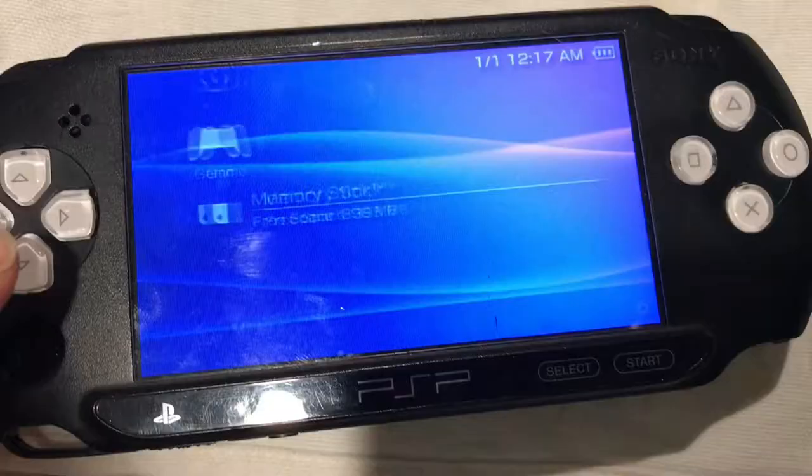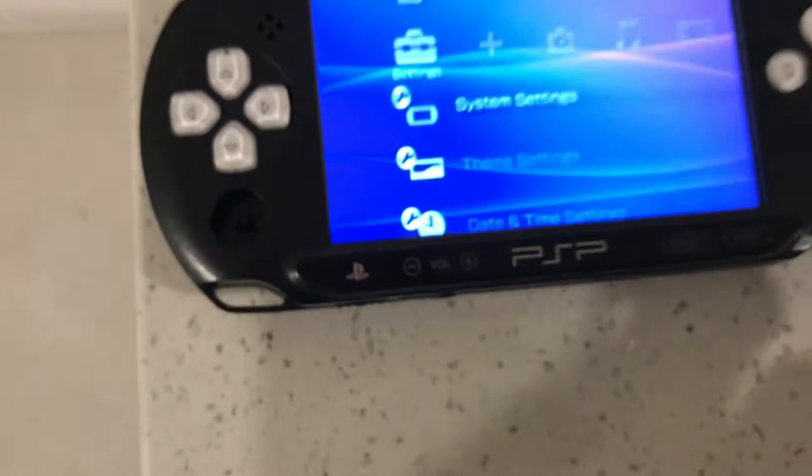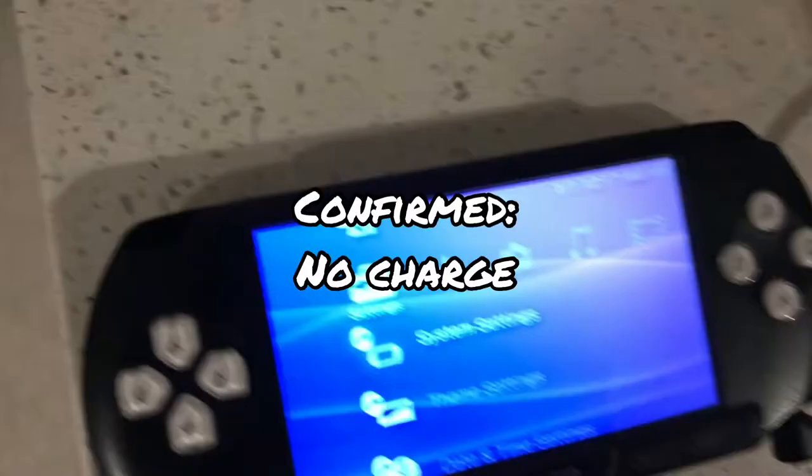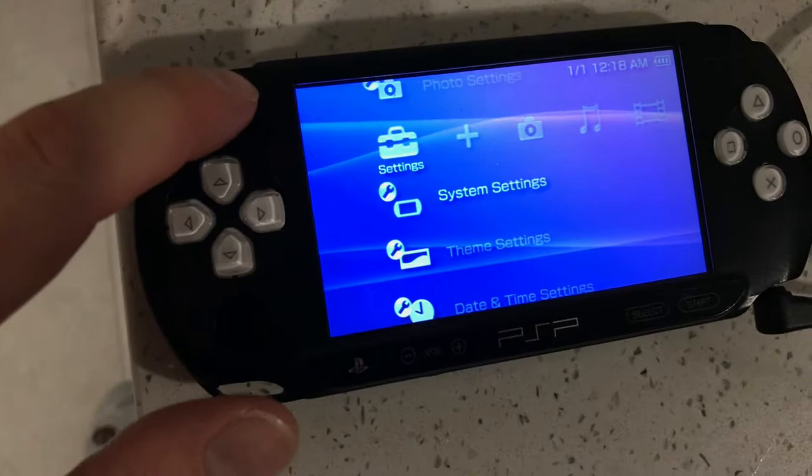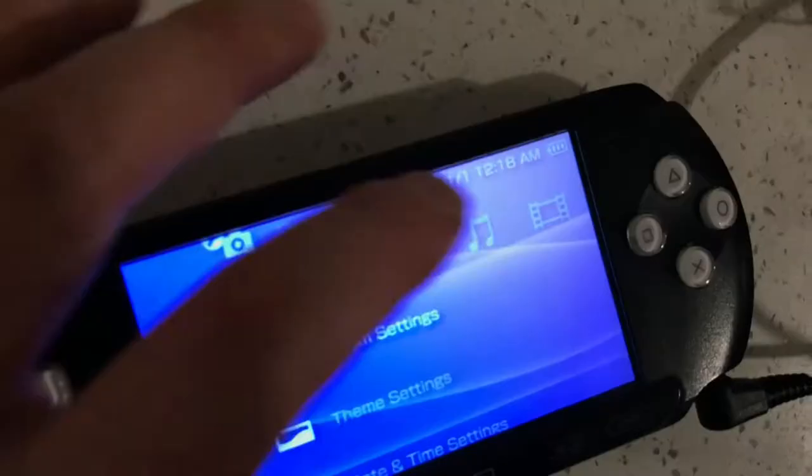The only issue now is that I don't think it charges, although I could be wrong, and no, it does not charge. So that will be the power fuse on the circuit board. So the next step is to pull it back apart, replace the speaker, install the joystick, solder the charging fuse, then put it back together one last time, adding in all the necessary hardware.